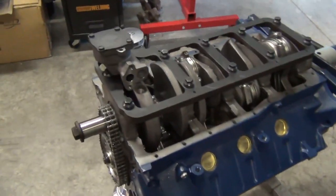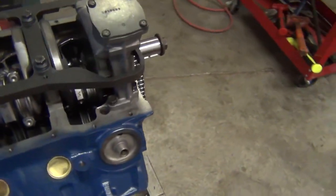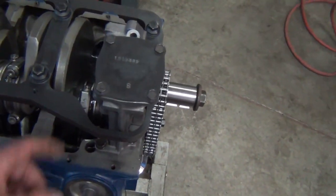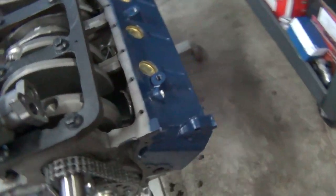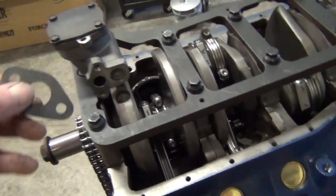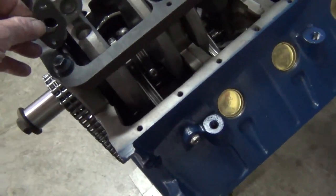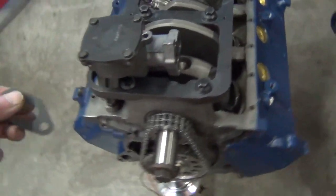I've got the oil pump on, bolted down, all the clearances good. The tightest spot was where the oil pump shaft is to the number one main bearing cap — I had 60 thousandths there, so we're good, with a little bit more between that and the crank. These oil pumps come with two gaskets: one gasket is for the pickup side for the oil pump pickup tube, and the other gasket goes between the block and oil pump. On a 302 they do look different but they can fit either way.